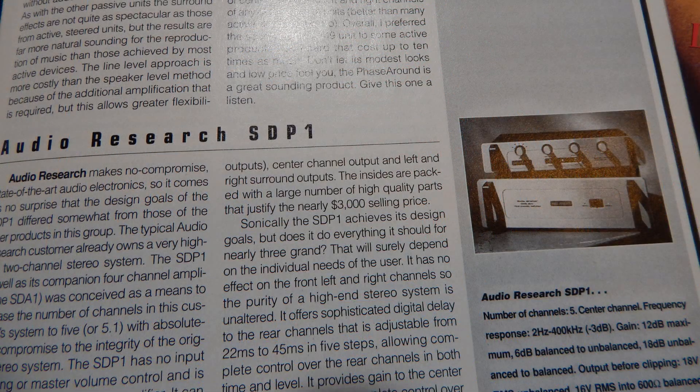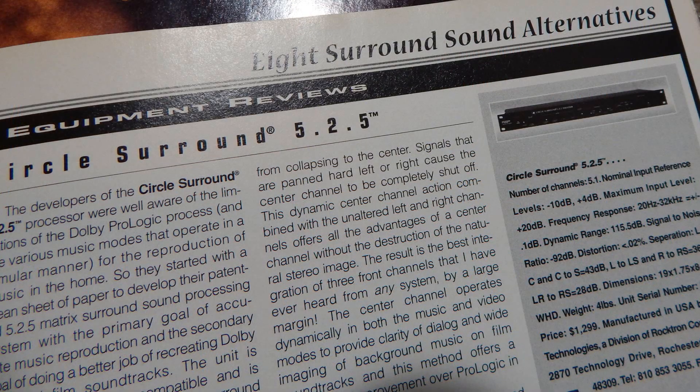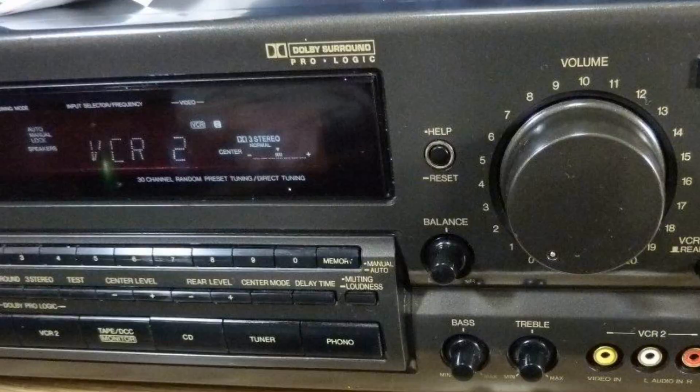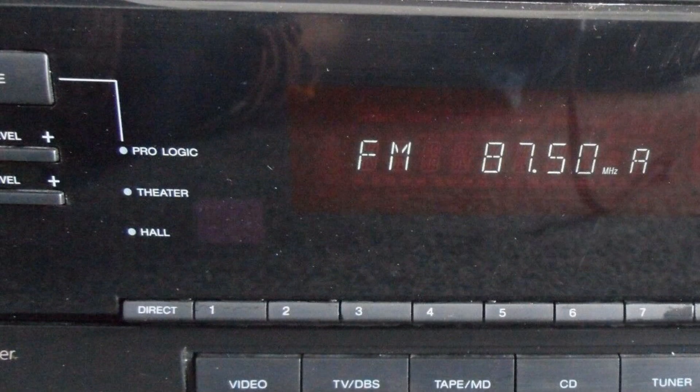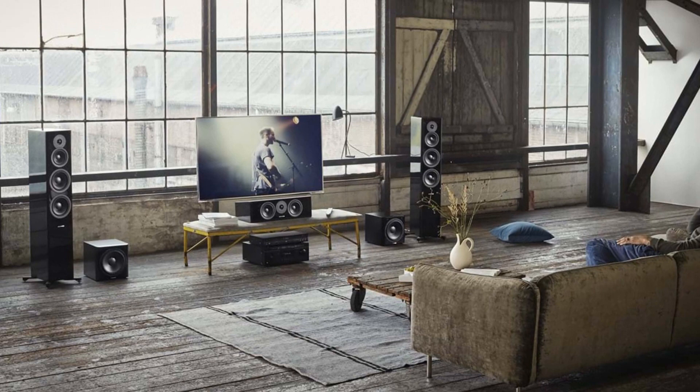If you want to dig into it, you can get competitors like the Chase surround sound system, and SRS had one with virtual surrounds. But straight-up matrix surround sound is easy to do and was in a ton of receivers — even modern receivers will have some version of Dolby ProLogic. That means you can choose from tons of awesome brands super cheap on Craigslist, Kijiji, or whatever equivalent — there are metric butt-tons of ProLogic receivers out there for next to nothing. Then all you need is two main speakers, a center channel, a couple surround speakers, and a subwoofer.